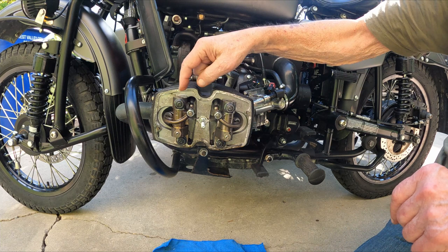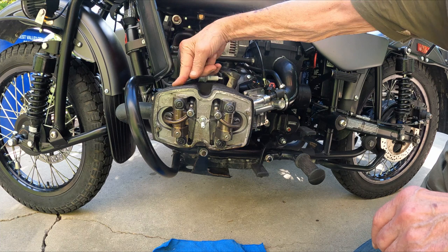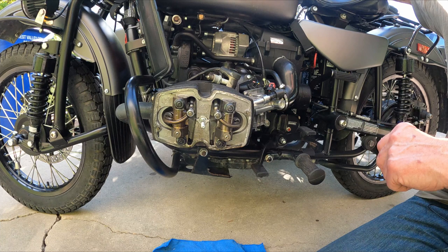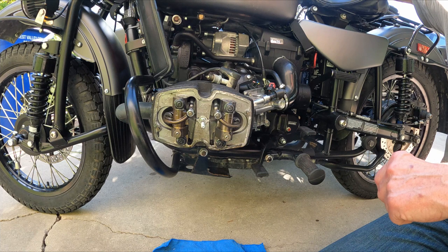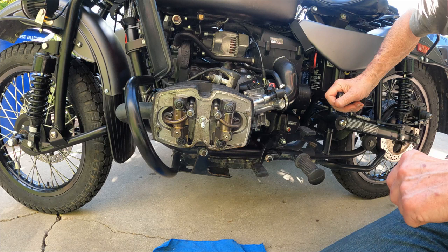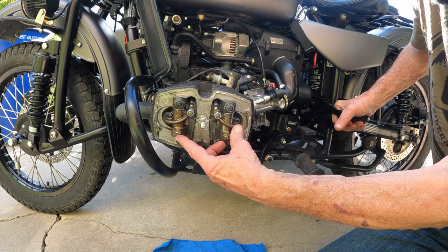So the first way — really the easiest way — is just by looking at the valves. This is the intake valve; this is the exhaust valve. The exhaust valve goes into the exhaust pipe and the intake valve looks into the throttle body. There are two top dead centers, but only one of them can you use to adjust a valve. On one of the top dead centers the valves are going to be under slight compression due to the cam.